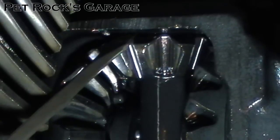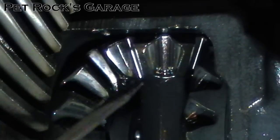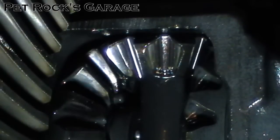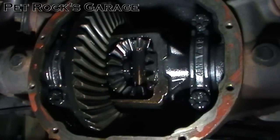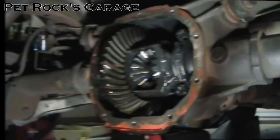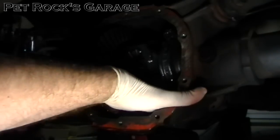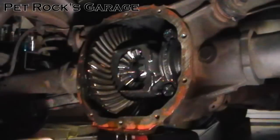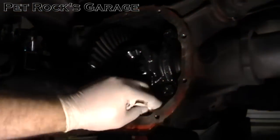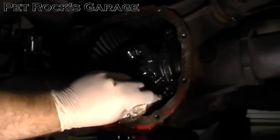Hopefully it's just that the spacer is worn out and not the housing itself that's damaged, because replacing spider gears in here is actually fairly simple — I'll be covering that under a separate video. Primarily while rotating, you're mainly looking for wear patterns and potentially loose or damaged parts. Once you've inspected all the gears, take a paper towel and scoop out as much of the remaining oil as you can. I'd advise putting on gloves because this is messy and gear oil just stinks.